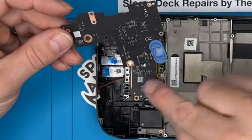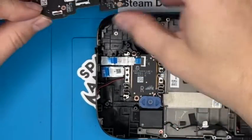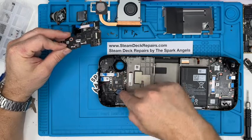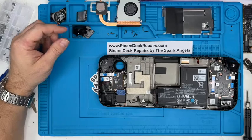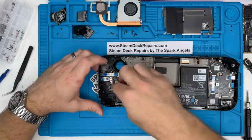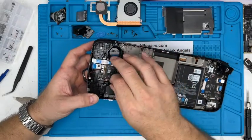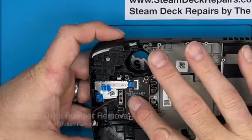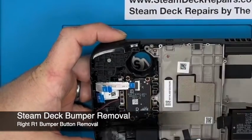There is the daughter board, and there's the back of the steam button actually. It comes with that little rubber gasket. Oh, gasket. Yeah, I guess it is. It's probably a bit of a seal. It's also a bit of a spacer as well. Daughter board. We'll pop that out of the way. We know the screws are there, so that's fine. In fact, we'll put the button there. The steam, the options button, menu lifts straight out, goes into that. You're left with the vibration board, and then the vibration thumb pad underneath.